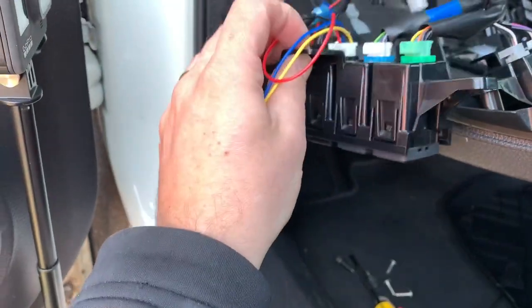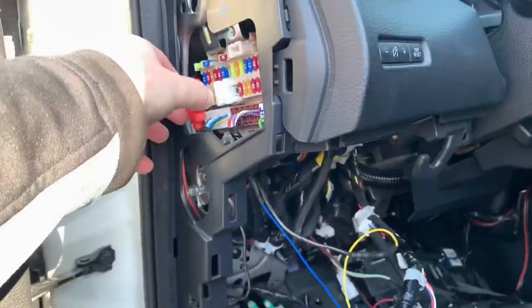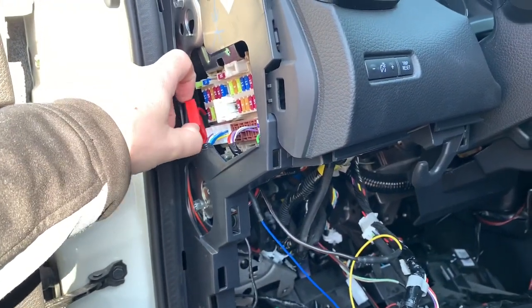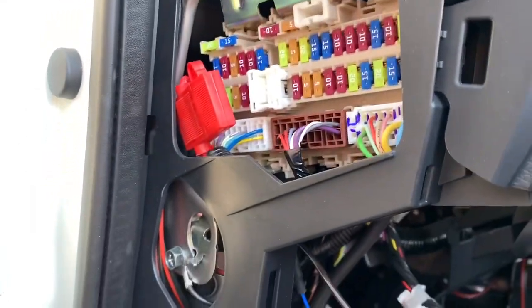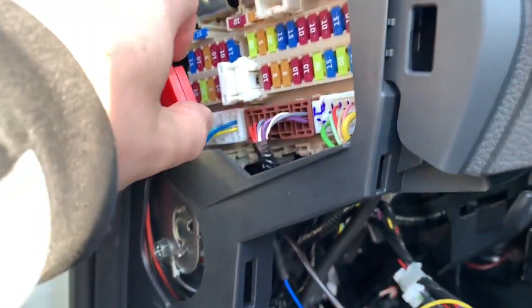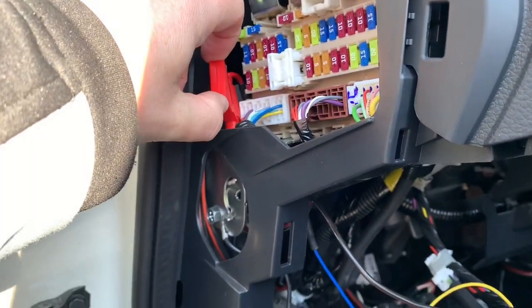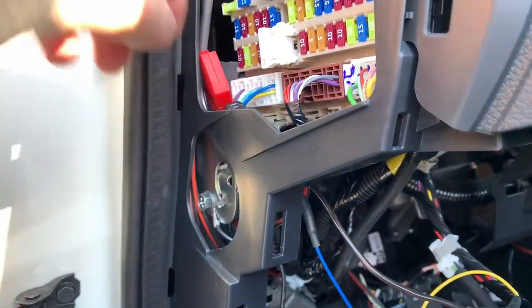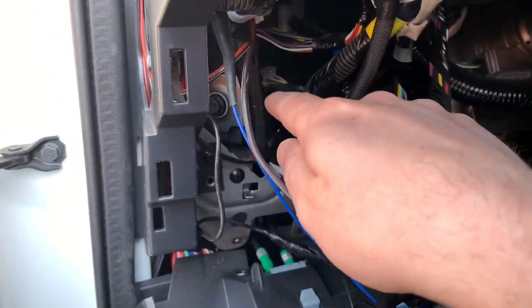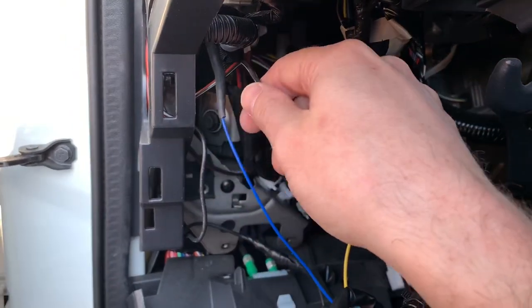I'm going to refix this panel in place and clean up the cable mess a bit. I will put the fuse just behind here — this way I can still install or replace the fuse when needed without having to open up everything. It will sit nicely here, and I've fixed the cabling going to the engine bay with isolation tape so it won't move.